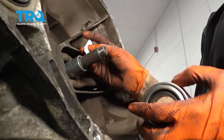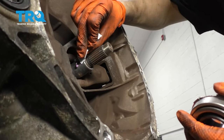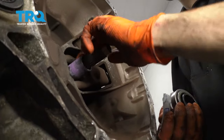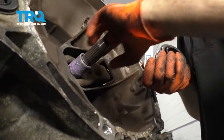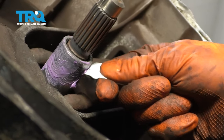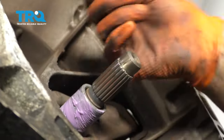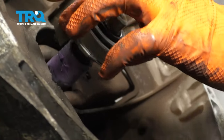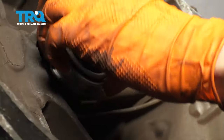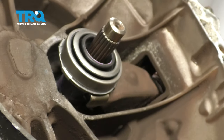Your clutch kit should have come with a little packet of grease — use that for the throw-out bearing. Just lubricate this area here. If you don't put any grease, this area can build up some surface rust and eventually it'll start squeaking every time you press the clutch pedal. It can also wear the throw-out bearing prematurely — not the bearing itself but the part that rides on the shaft, just because it's dry. There's a reason they don't provide you with a lot of grease — you don't want a lot of grease. Now take the throw-out bearing, press the fork out, hook it on. Make sure it's properly secured top and bottom and go through the operation a couple of times to make sure nothing's binding.